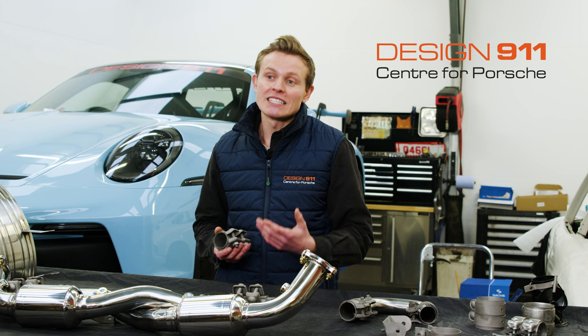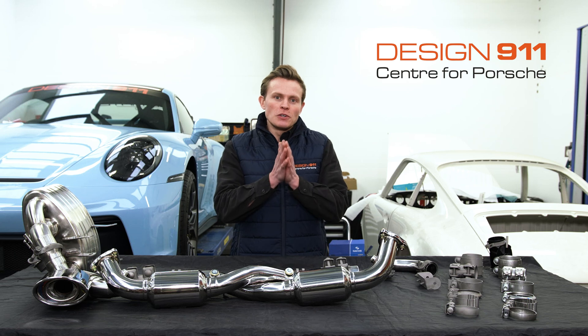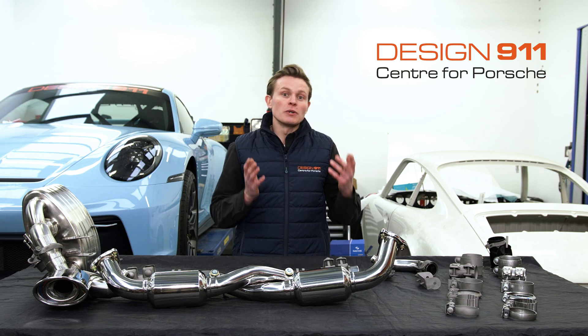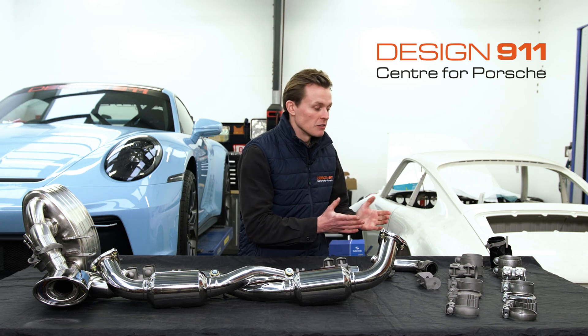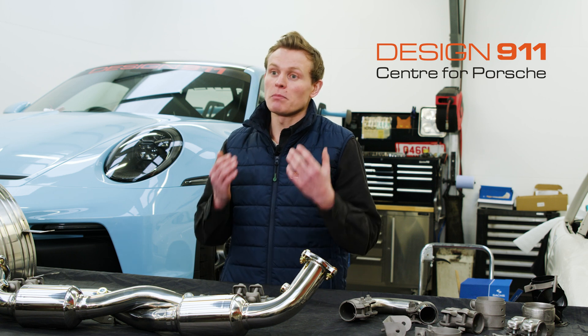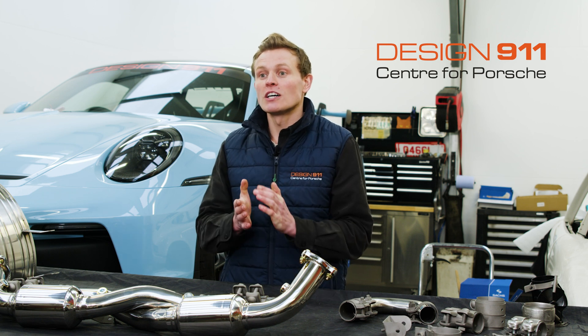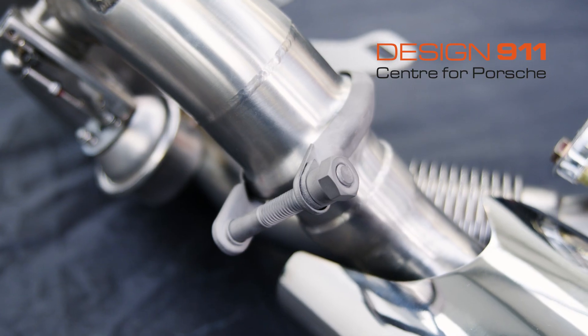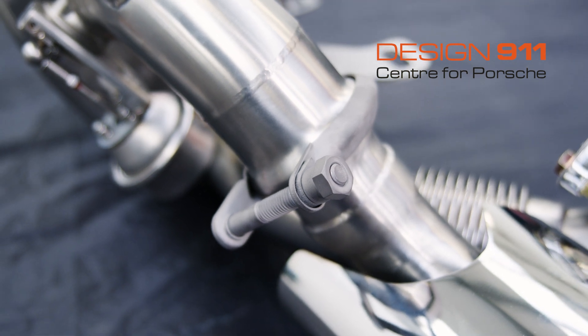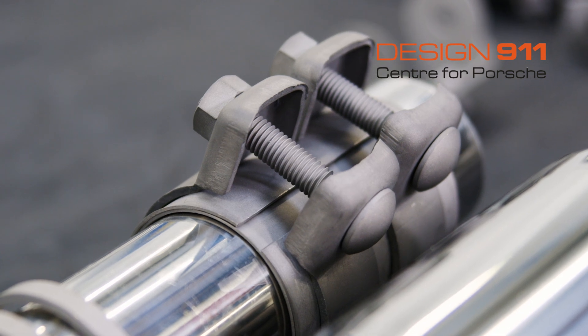Roller are continuously adding to their range of titanium clamps and titanium exhaust fastenings and fixings. You might be wondering why to upgrade your exhaust clamps to titanium — there are some very good reasons. If you ever have to take your exhaust system off and your original steel clamps have started to corrode, undoing them is going to be a nightmare. If you upgrade to titanium, your exhaust clamps and fastenings will not rust — you'll simply be able to undo the clamp and take your exhaust pipes off.